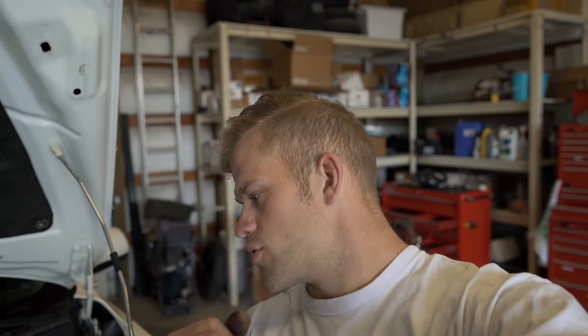Now this is the kind of hard part — I don't know whether to pull the turbo off first and then the manifold, or pull them off together. When I dropped this motor out to build it, I dropped the motor with the turbo and manifold on. Obviously I'm not going to drop the motor just to swap the turbo, so I think I'm going to try to get the turbo off the manifold first, then pull the manifold. That's all we need to pull off — downpipe, intake, and upper intercooler pipe are already off.